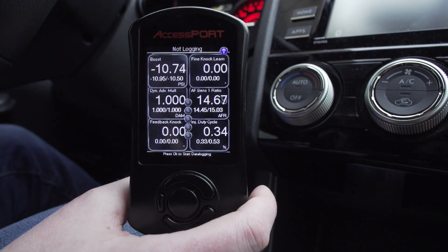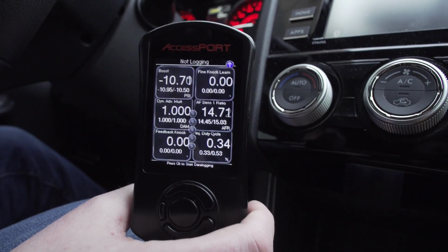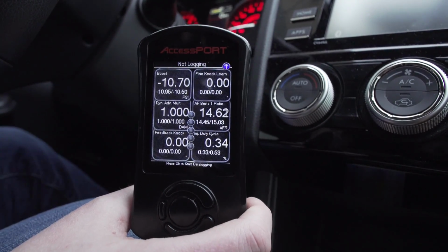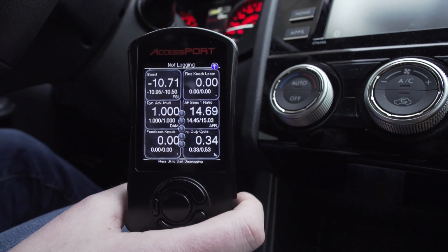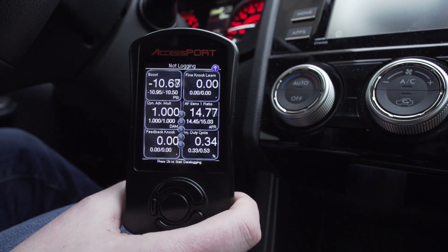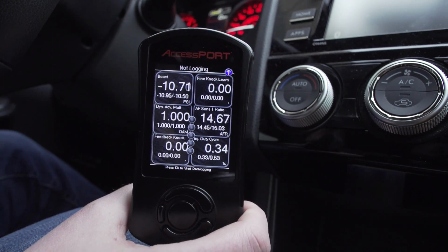As I mentioned before, let's say Gary from Gary, Indiana, is always getting DAM dropped to 0.6, and it will never go up. Every day he tries to drive it, DAM is constantly dropping, he's getting tons of knock, he's tried different fuel, etc. Now he's kind of stuck. That's when we'd probably request the customer to send in data logs.